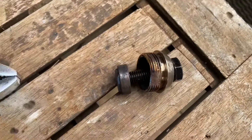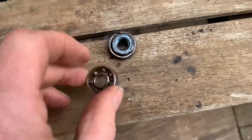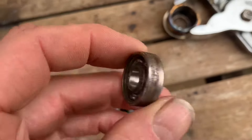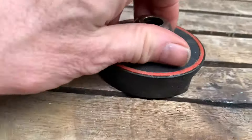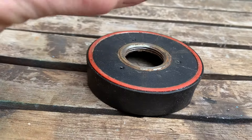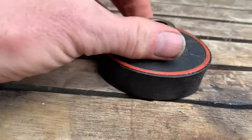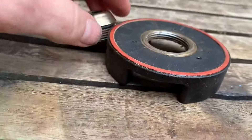We can now set about putting some new bearings in and putting the whole thing back together. Where there's a will there's a way. That's the bearing that came out easily, that's the second one that disintegrated — it's still got the nut wedged in there. These are just standard skateboard bearings. A lot of people after replacing the bearings end up with a leak in their Vitamix — make sure when you put this back together that this screws down all the way. Often there's grease and rubbish stuck in the threads, so go over them with a wire brush and clean out all the gunk so it screws down fully and doesn't stop halfway and fool you into thinking it's tight, because that will give you a leak.